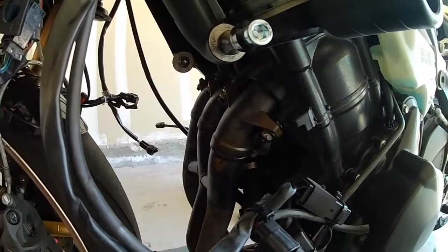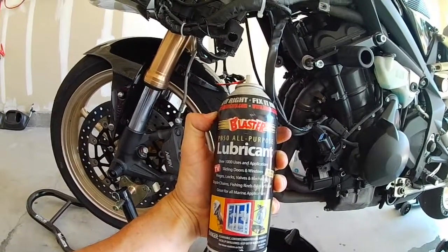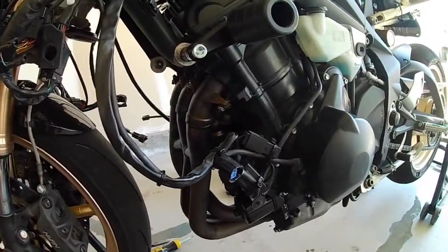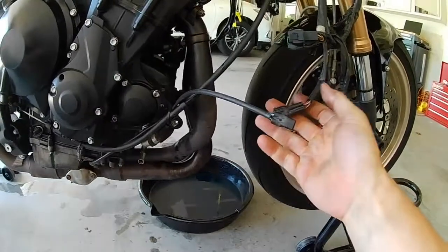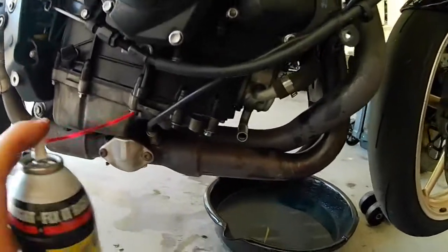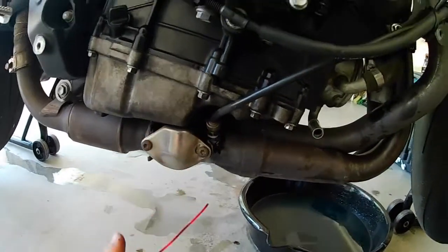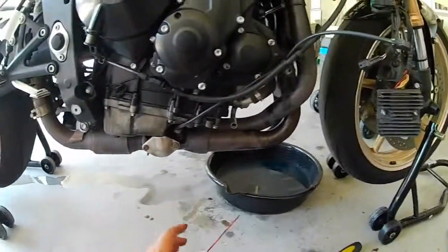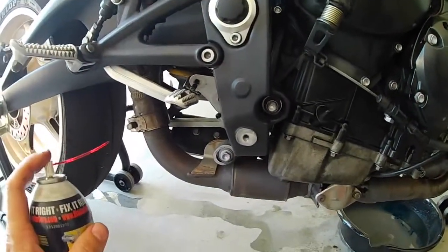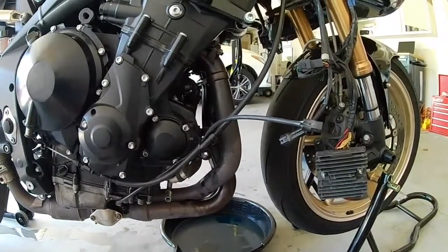There's the stock header slash exhaust manifold. Before you get too deep into the project, you're going to want to hit it with some type of lubricant ahead of time to help so that we don't break any of those nuts off when we take it off. There's also going to be some clamps near the back. You'll see this cable right here — it has to be disconnected; it goes to the O2 sensor. Make sure to hit that with some lubricant as well. A little bit of PB Blaster on this bolt and that bolt.